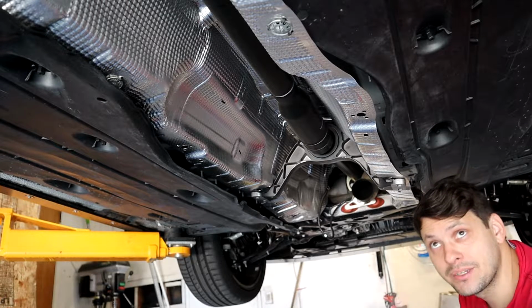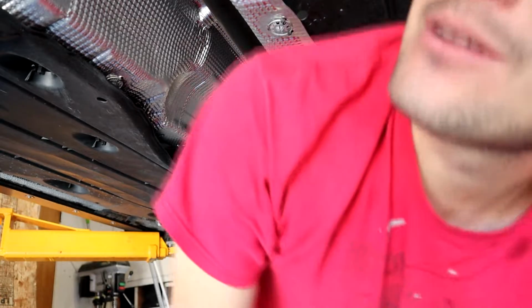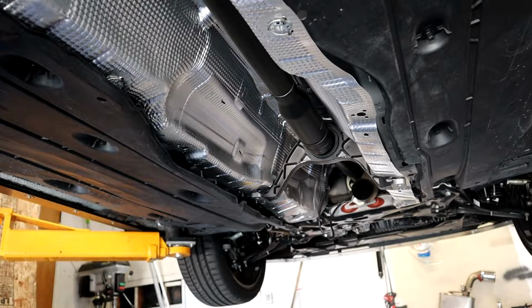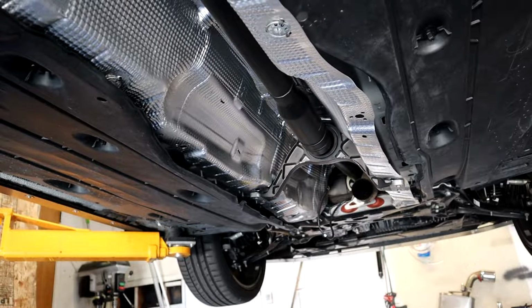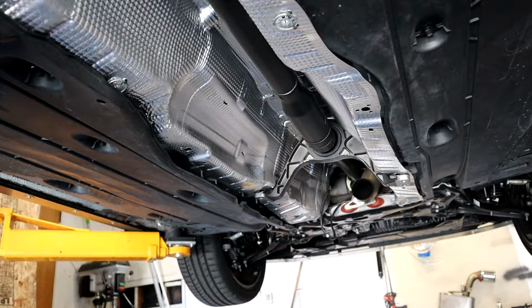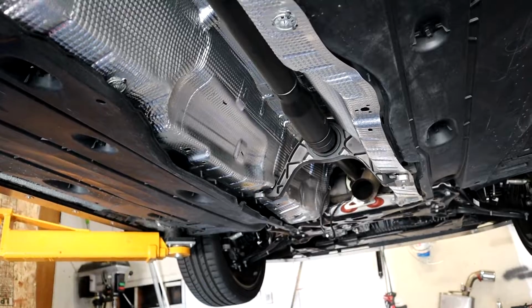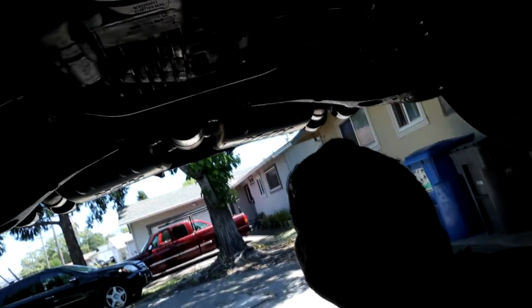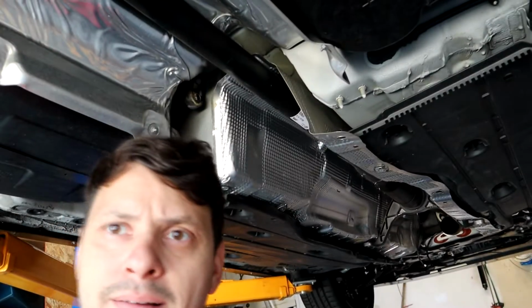This should be fun. So I'm gonna take those bolts off in the back, and then I'm gonna go take those off, and then, oh, it's in park, isn't it? But it should still rotate in the back. No, it should. Wait, it's not automatic. Why isn't it spinning? Okay, good. I can spin it. So I'm gonna take those off real quick and drop the drive shaft down. It's just gonna be these 3 bolts, then I'm gonna pry it with a pry bar. Yeah, it's gonna be these 3 10 triple squares, and then I'll be right back.